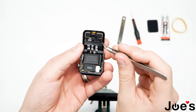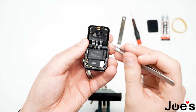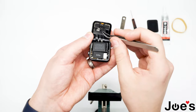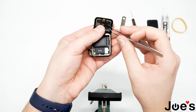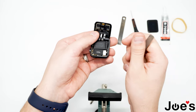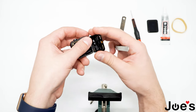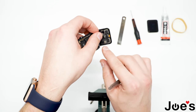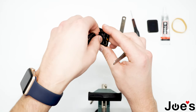Take this grip tool that lets you get into small things. There's going to be a plastic cover — like a film — covering each contact point so they're all aligned. I like to pull it up a little bit; sometimes they try to fall back down, so lift them back up. Do not remove that plastic piece — it's what holds the whole screen together and aligns the screen so the contact points fit nicely and you get no errors on the watch. Don't lift too much because you can break these three contact points off the old screen.